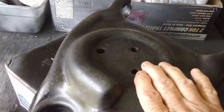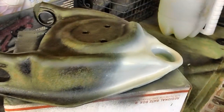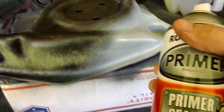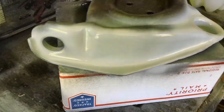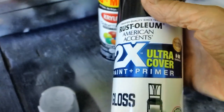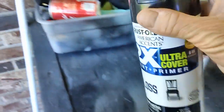I'm going to put some nice gray primer on that, and then go ahead and spray it with nice gloss black primer and paint combination. That's what you're looking for, guys — this way you've taken care of everything, and that'll last forever. It probably would have lasted forever without it, but I like putting that rust reformer on — it makes a big difference in my mind. This particular primer, the automotive primer, is difficult for me to find anymore, so I switched over to this primer sealer by Rust-Oleum. This stuff works just as good, if not better. I like it because it covers fast.